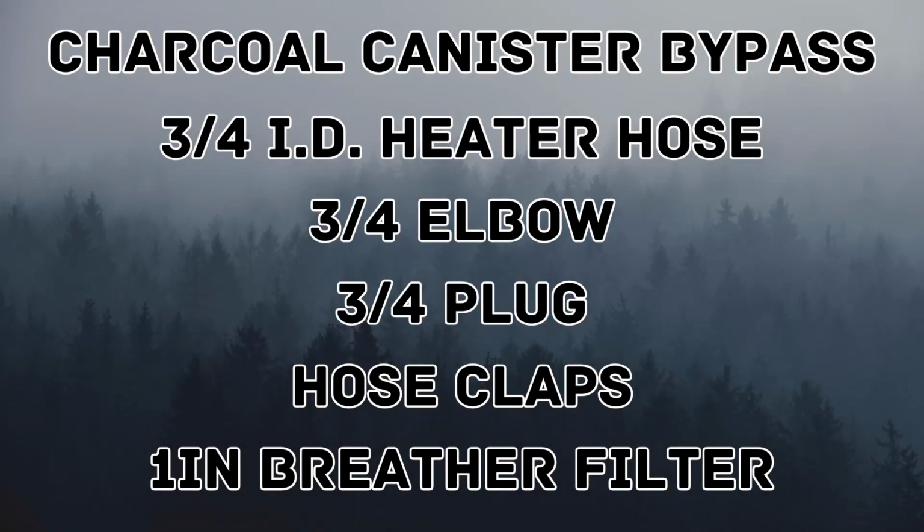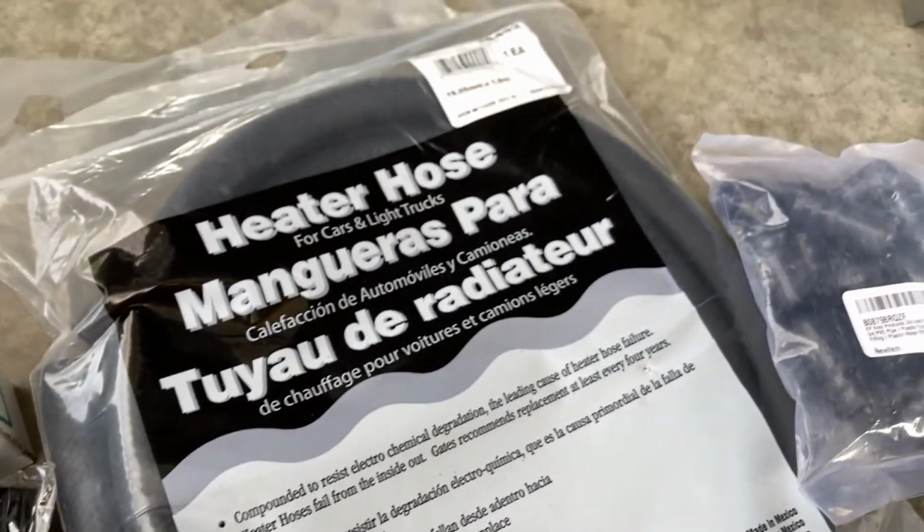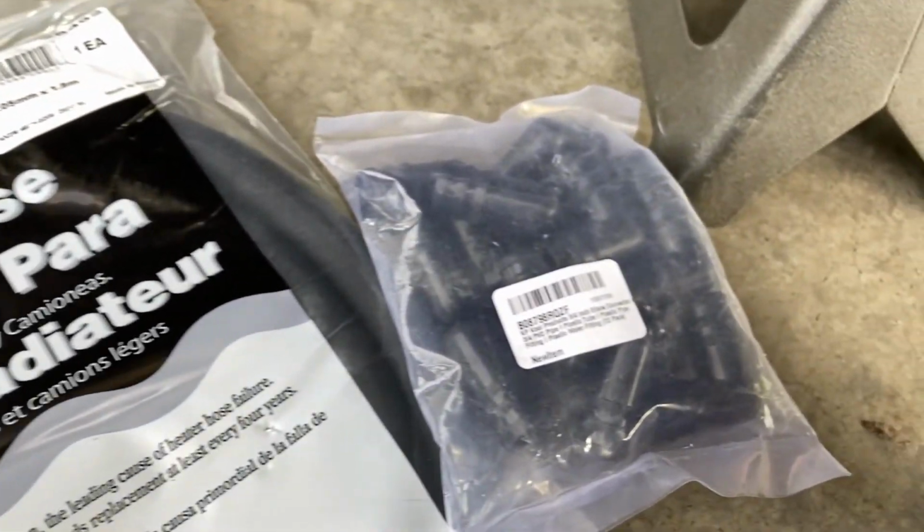We're going to start with the charcoal canister bypass. For this, we are going to need some 3/4 inner diameter heater hose, a few 3/4 elbows, a 3/4 inch plug, some hose clamps, then finally a breather filter with a 1 inch hole. All of the links to what I've used are going to be found in the description below.